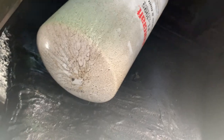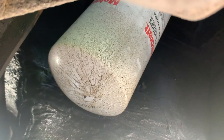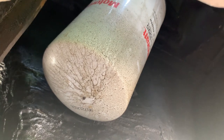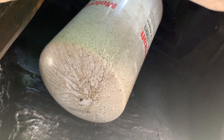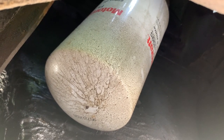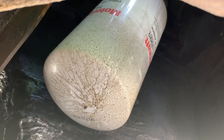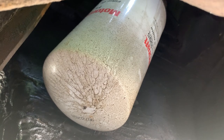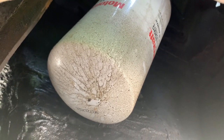Yeah, it would be a pain — it used to take me like a half hour. This thing, it's literally like a tug on it and it comes loose. Like I said, it's two quarts of oil in here, so I pretty much give it a little bit of a turn, some of it comes out, let it drain, give it more of a turn, more comes out. Then it's usually about a quart and a half that I leave in there, and I just use my hand to make sure I don't spill anywhere.